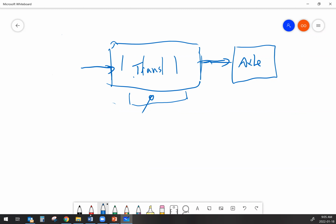But nowadays, thanks to electronics, we can strip all of this away, and we can have a valve body that just has a bunch of solenoids that let us select our various different clutches and brakes that we want, and therefore output speeds.